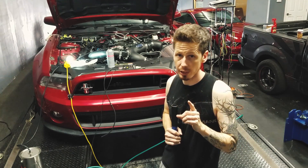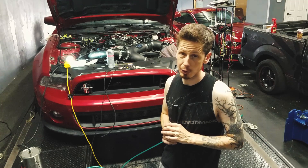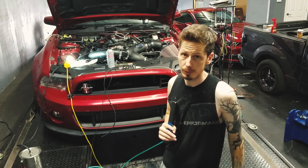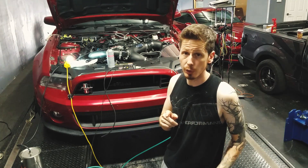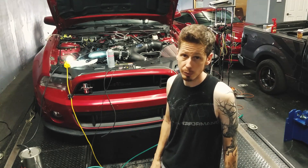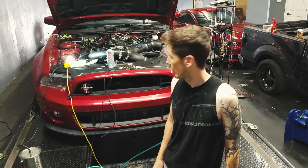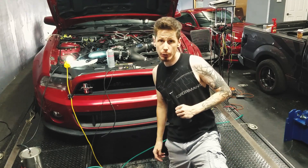We only found one leak, but unfortunately it's in a very important location — the TIP sensor has to be flush with no leaks whatsoever, so that's kind of a deal breaker. We're going to try to fix that. I'm using this opportunity to clean the sensor, and I'm also going to take off the MAP sensor and clean that out as well — hopefully no other issues.